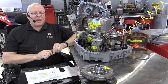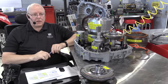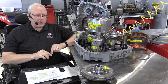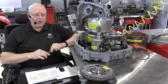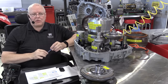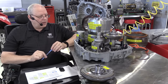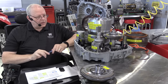That is not something that happens on the Ford or the Toyota systems up until at least the absolute latest generation. I've been hearing rumors that the 2017 plug-in Prius Prime has the ability to use their small MG1 to help propel the vehicle down the road with the use of a one-way clutch, kind of like the first generation Ford Escape transaxle.